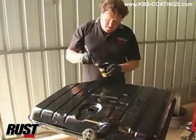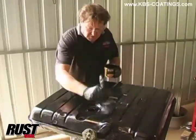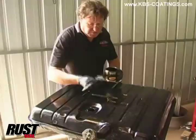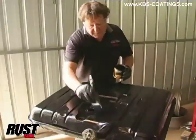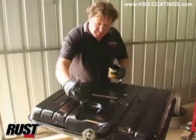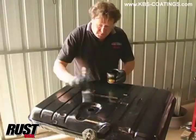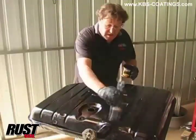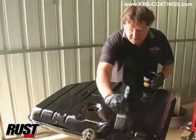We've left that sit for a while. One thing I have done is come back and worked a bit of paint through the brush, just to make sure it doesn't go off while the rest of it has gone hard. So we're going to give it a second coat now - this will be all we need to do on this one. This puts an external coating on what's already done internally. With this one we did have to fix up some leaks, but it's cheap insurance really. I've got another one I'm putting together - a '41 pickup with an old Holden one-tonner type fuel tank - I'm going to coat that one as well. Don't have to do any repairs, but I'm still going to do the same internal coating process, because it's around about a hundred bucks for the kit, and that's cheaper than a breakdown from a blocked fuel filter or rubbish in the lines.